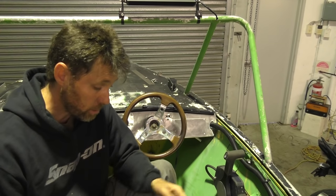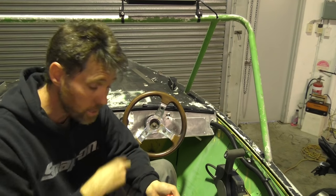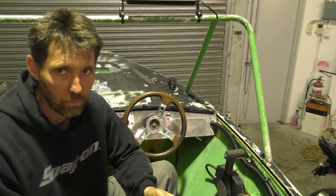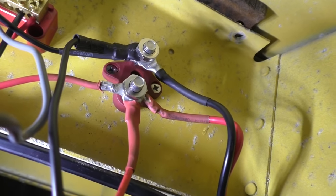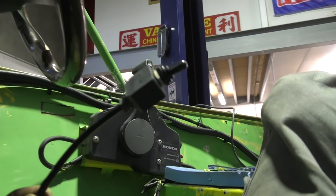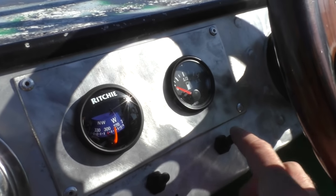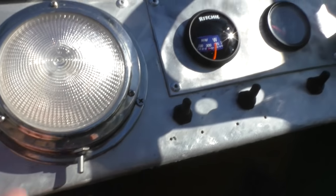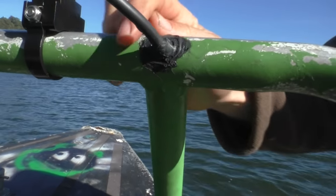What I'm going to do now is go and take the fuse out of the battery box so I can connect the positive and negative main power leads to the terminal block under the dash without risking arcing a spanner between the two. We've got the wire coming from the light down through the deck, positive and negative wired to our two pin terminal block, relay and fuse holder which I'll secure with cable ties. The switch has to go through the dash. The switch is now mounted — we're out on the water in daylight. I've got this switch pushed through from the back with a waterproof jacket over the top. All the rest of the wiring is under the dash, held up neatly with cable ties. I've put a lot of Sikaflex around the hole where this wire came through — not particularly neat, but I might get a razor blade and tidy that up.